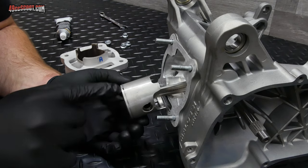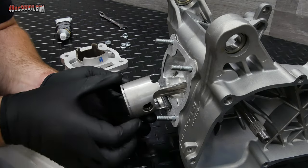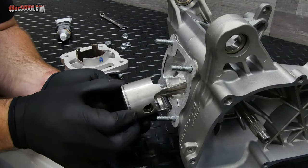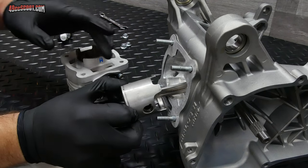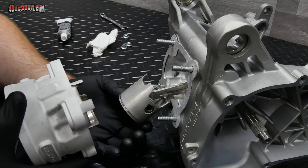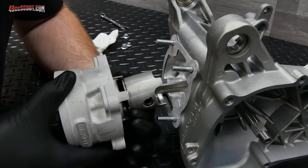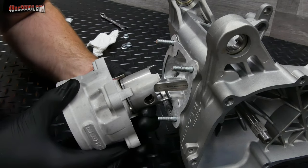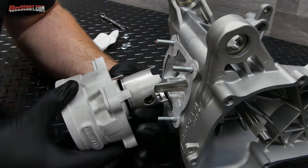I need to make sure that the gap in the end of the piston ring is aligned with that locator that I showed you earlier. And as it goes on, I will have to try and hold the piston ring to compress it against that locator dowel. That way it will allow the piston to easily slide into the cylinder. So I'm going to hold this from the bottom or sides, get that aligned a little bit, and squeeze that together. I'd have to make a small adjustment here in the ring